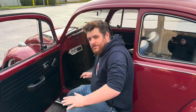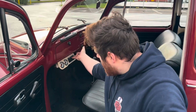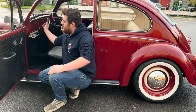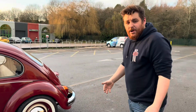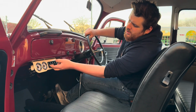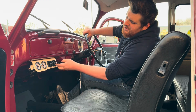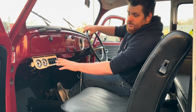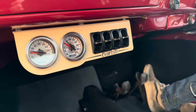So as with all our premium stuff, it's got a lot of lift, which is nice. So we can take it to pretty much stock height in the rear, if we wanted to. And then, not quite as high as stock in the front, but still plenty of clearance to go over absolutely any obstacle you might come across. Cool. So I tend to drive it at about 40-ish PSI in the front and about 60-ish in the back. A little bit more pressure on the driver's side just to account for my weight. And there you have it, that's pretty much at ride height, as quick as that.